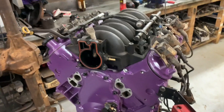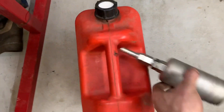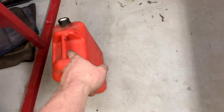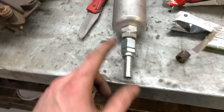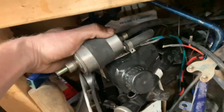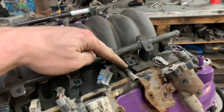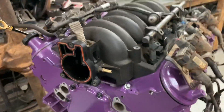We're getting extremely close now. Let's just bolt the throttle body on. I've got my fuel pump 90% figured out - what I'm going to do is leave this pump outside the tank. This will be a hose just going into that gas can, and then I'll have a fitting coming out of here to the Corvette fuel pressure regulator, which is going to regulate fuel pressure, and then directly to the rail right here.